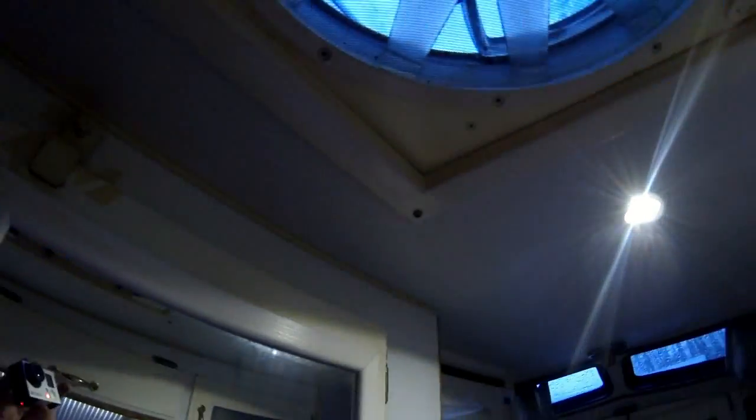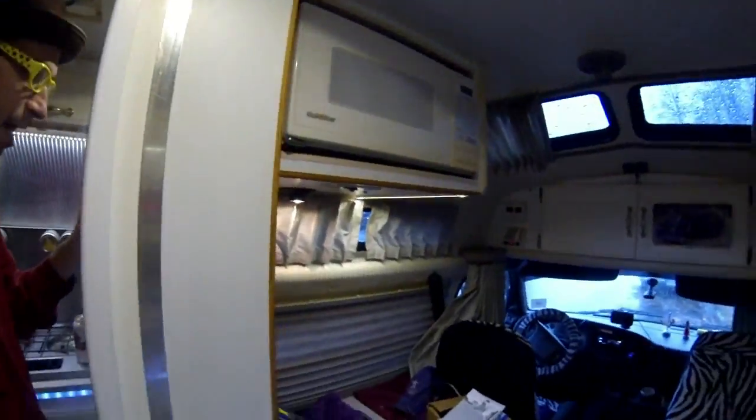So even the bathroom, yep, even that's LED. Now, one thing you're gonna notice is it looks like incandescent, right? It's a really nice warm white. Well, that's something you're probably gonna wanna do when you look for LEDs, is make sure you look for warm white, or put warm in your search. Like, for example, LED 12 volt warm. That will find you thousands of LED bulbs like this. These are warm white, unlike that cold white that standard LEDs come in.